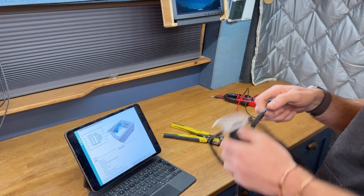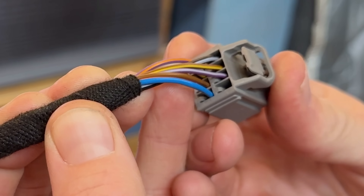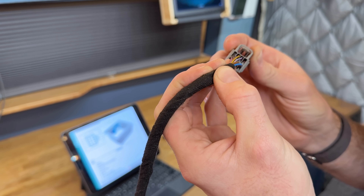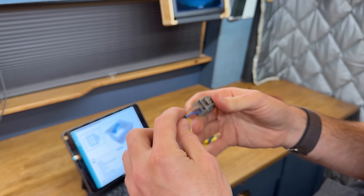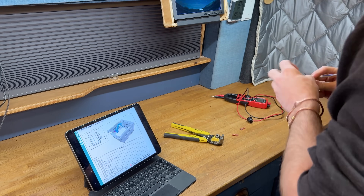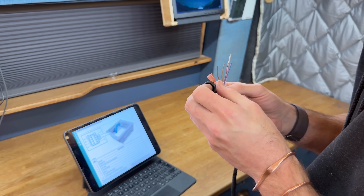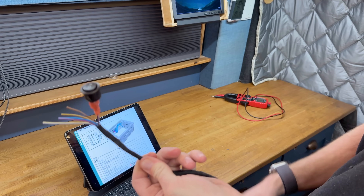From looking at the orientation, I need to use pin cable three — the smart regenerative charging inhibit pin — which is the purple/lilac wire, and the dark black and white. So: purple with gray, purple with lilac, and black is ground. At the other end we've got these two pins that I need. And there we go — that should be my little switch.